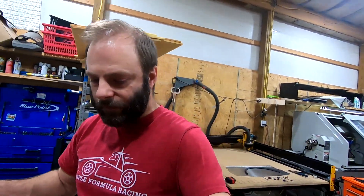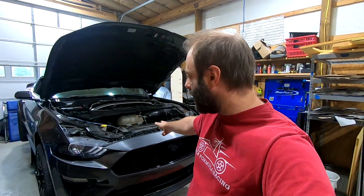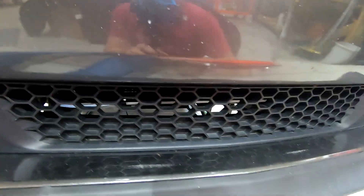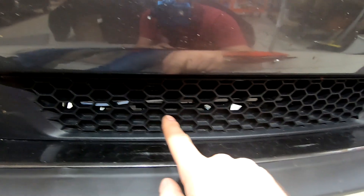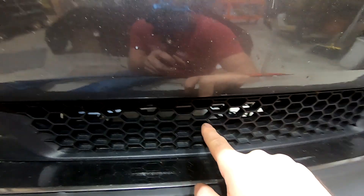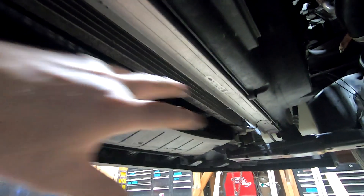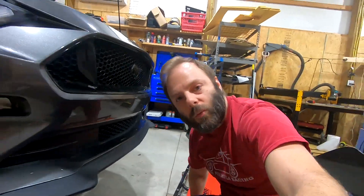We're working on splitter kits and a handful of other things for the 18 to 23 Mustang, and when I was removing the factory splash shields — plastic, whatever you want to call it — we ran into a bit of an issue. If you look through the grill, you can see all the daylight under there because there's your radiator and condenser with a huge gap right there. Now coming underneath, there's the grill we were just looking at — I can fit my entire hand in there. So what that means is a bunch of air coming through the grill is just going to be slipping out the bottom. If you've watched any of my old videos going to the wind tunnel, sealing up the front side of your radiator is one of the best things you can do for not only cooling but efficiency of the car.